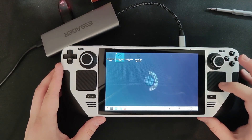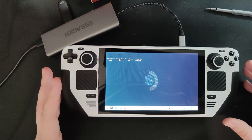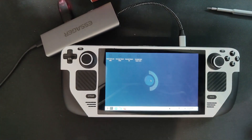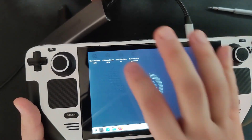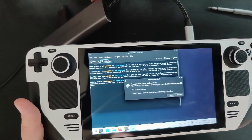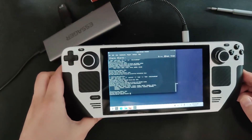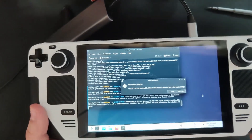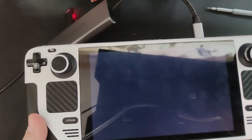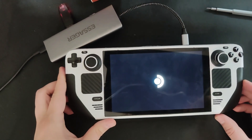We have four icons on the recovery screen. You can use the mouse with the trackpad. Once you get to this screen, click on Re-image Steam Deck, click Proceed, and let it finish. It seems to be done now — it's prompting you to complete the process. Just click Proceed. The device will restart and you should see the SteamOS starting screen.